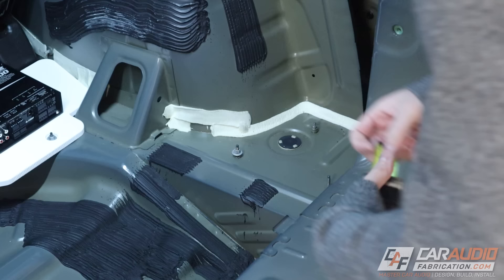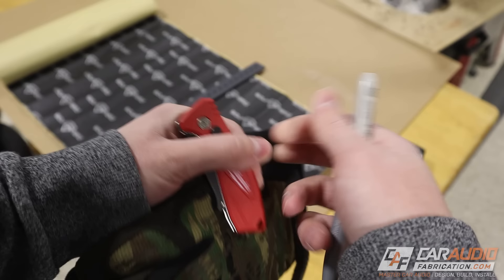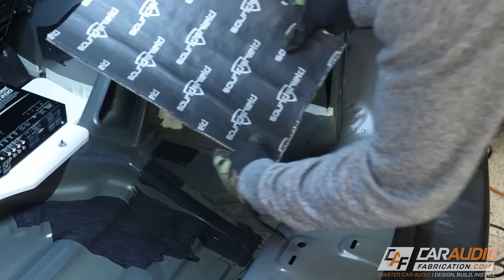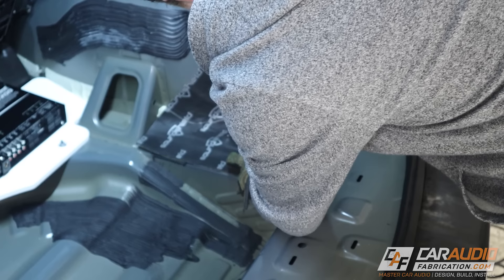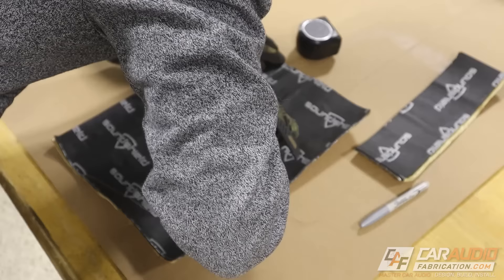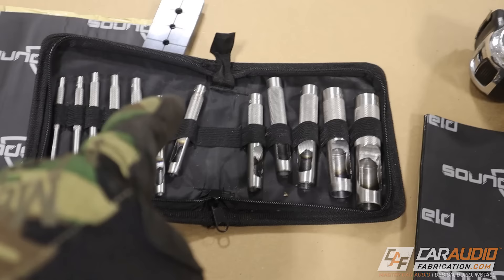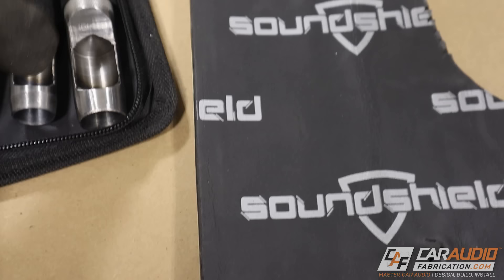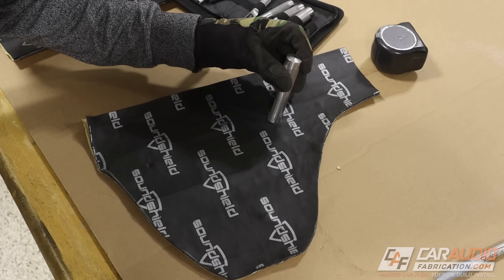I'm going to start with measuring out this area. A couple of things you're going to want are a good pair of gloves to protect your hands, a really sharp knife where you can swap out the blades, and a silver Sharpie comes in handy for marking on top of this black material. I then cut a rectangular shape of those dimensions. I position the piece and push some of the threaded studs through it to mark those bolt locations. I also push the material down into the corners and try to avoid any cutting inside the vehicle itself, using the silver Sharpie to outline where I need to cut. Then I trim that excess material away. I never throw away any scraps because there will inevitably be small areas in the vehicle that I'll need to tuck these into. Now the next thing I'm going to show you is life-changing — you definitely want this punch set if you want a nice professional-looking finish. I'll put a link to it in the video description. We pick out the proper hole size, put it over where I pushed the studs through earlier, and then use a hammer to give myself a perfect round cut.